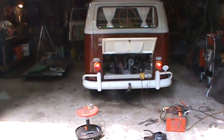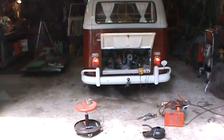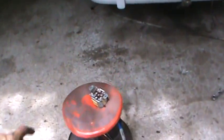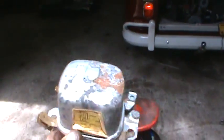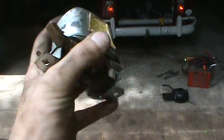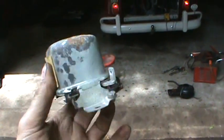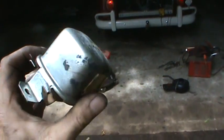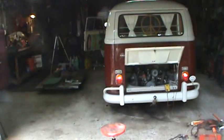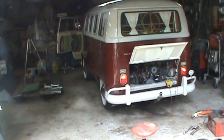You want to be slightly higher than battery voltage so the battery is always in a positive charging state, not a discharging state. The troubleshooting turned out to be my voltage regulator. My old one looks newer than the one I just installed, but that doesn't mean anything with electrical components. I'm going to mark it 'no good' and reinstall it in the bus out back so all the wires stay connected and it can still run if needed. Hope this helps somebody out with air-cooled VWs — thanks for watching, commenting, subscribing, and take care.